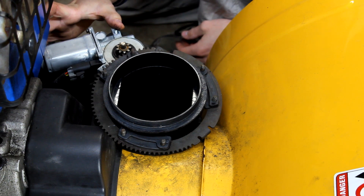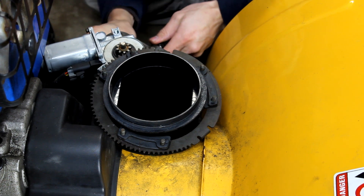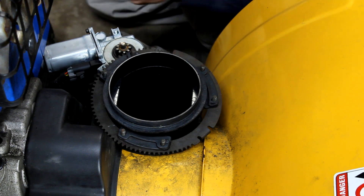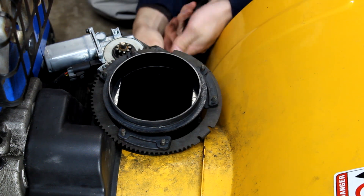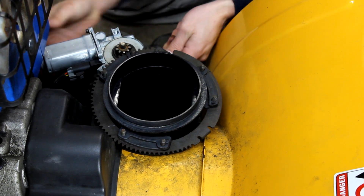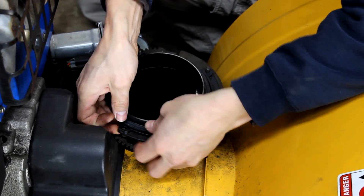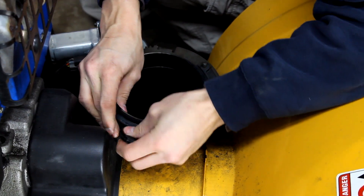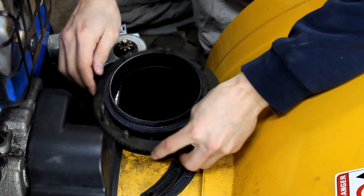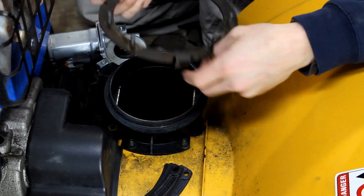Now you have this motor here. I can't spin this because this gear is blocking it. There are two bolts holding this motor in if your unit's equipped with it. I remove the bolt here and loosen the one here, and now I can swing this out so it can turn any way I need. Now we need to remove three pieces of plastic — two are easy and then you spin this to get to the third one. And now this wheel will come right off.